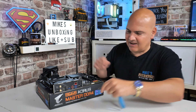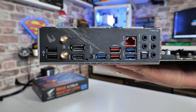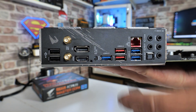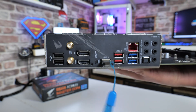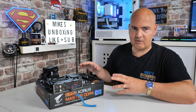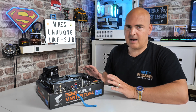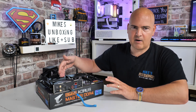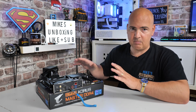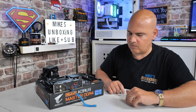With all that said, let's plug the USB flash drive in. It does have to be in the right port — it says BIOS next to it, so make sure you plug it into the correct port. When you're ready, turn on your power supply. You should find that your board does not try to power up. If your board does power up and fans come on, something is wrong and there's a short — that shouldn't happen. If that occurs, the flash process will not work, so work backwards and see what went wrong.